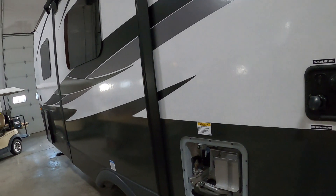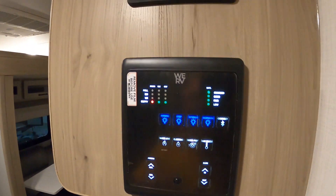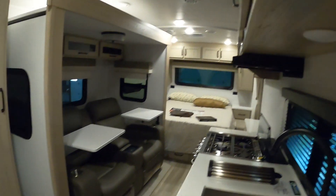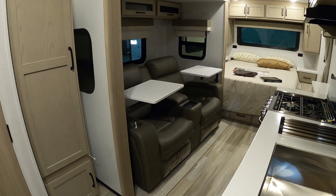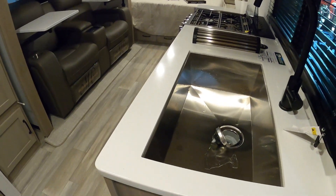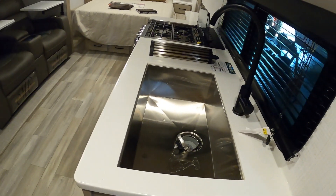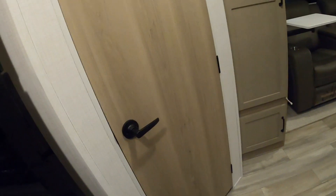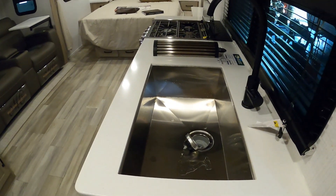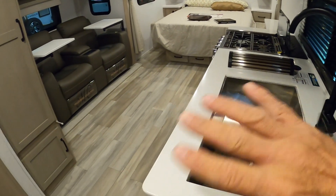After the hose has been on, go ahead and open up the slide. Up inside the unit, to the immediate right, is the control panel — the slide control is in the bottom right-hand corner, and hit 'out.' The reason to get the slide open is to access all the water lines. Open up your sink, shower, and bathroom, get the water flowing steadily to push all the air out of the lines, then shut them off. Once shut off, you're all set to camp.